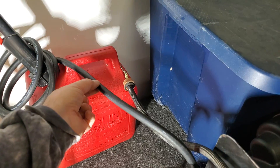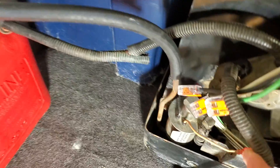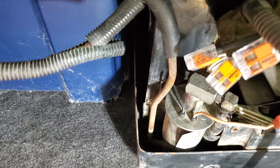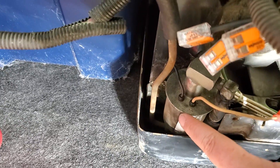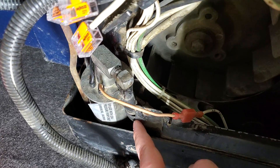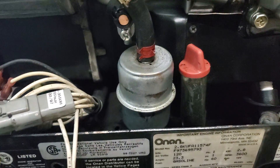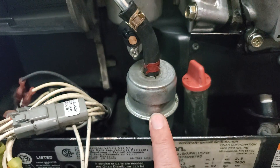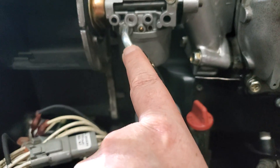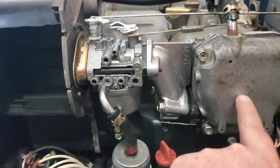The last thing coming in at the back left-hand corner is your fuel line, which connects to the fuel pump intake. The fuel pump is down at the bottom corner — it's a low pressure fuel pump. Fuel comes out on this side through a black cable that travels along the intake baffle at the bottom, goes underneath the controller board, and connects up to your fuel filter, which is the silver spaceship-looking thing in the center.